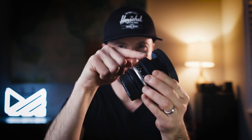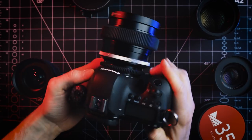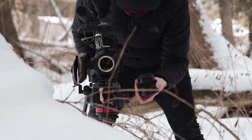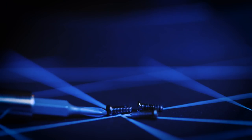Gears similar to your focus system can be installed on your aperture ring to help with controlling your settings — I do love a nice smooth aperture transition. Now all these lenses have dedicated EF mounts installed, which makes them seamless when mounting to an EF mount camera. It fits better and more secure than an adapter and eliminates the middleman connection point between the lens and the camera body. The dedicated EF mount sits directly on the native camera mount. To install it, simply remove the native screws, put the EF mount on top, screw it down, and there you go — you now have a hard-mounted EF lens.